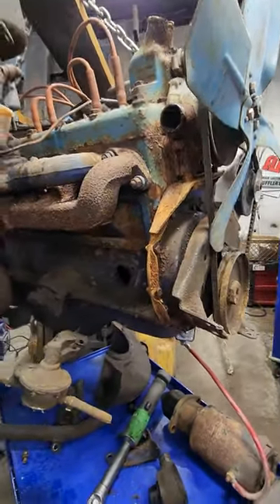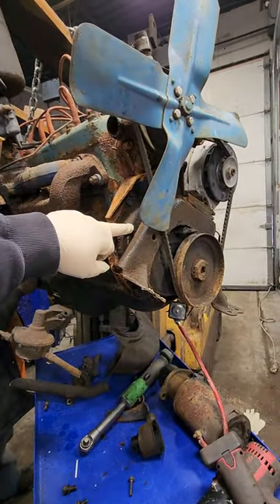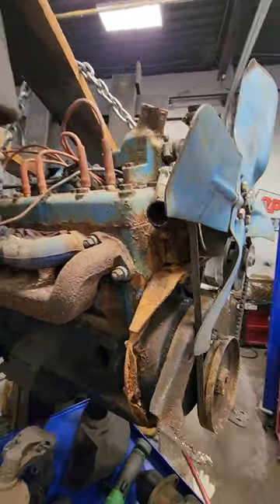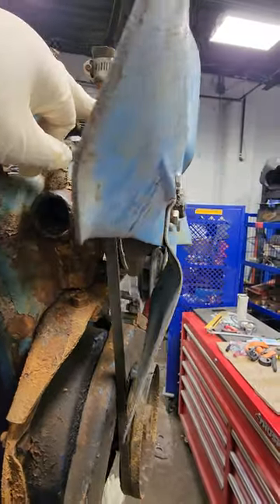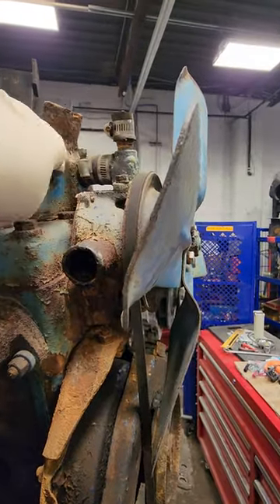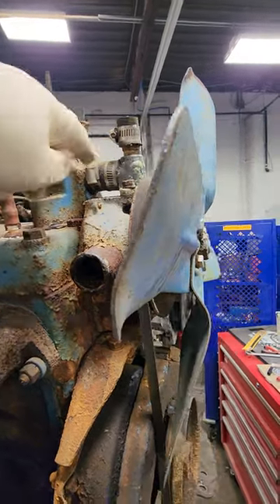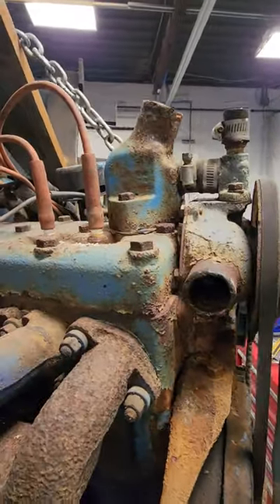So, just a little rundown. Here is your timing cover, a fan which cools off the radiator. There's the water pump which sits behind. This is your bypass. Water flows through here through the thermostat, and eventually when the thermostat opens inside here, it travels first here and then it circulates through the engine as it warms up.